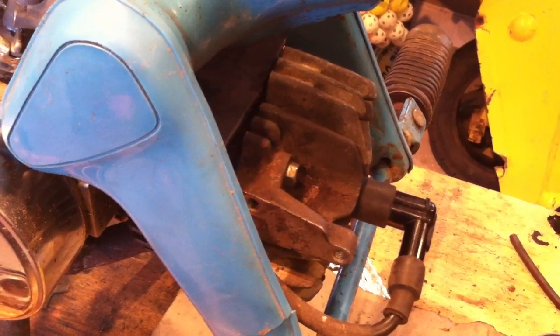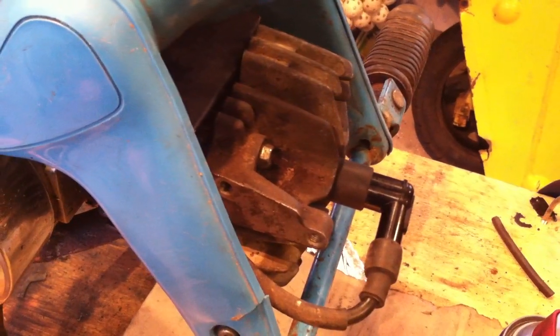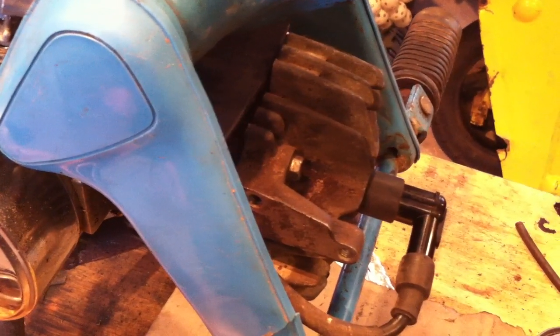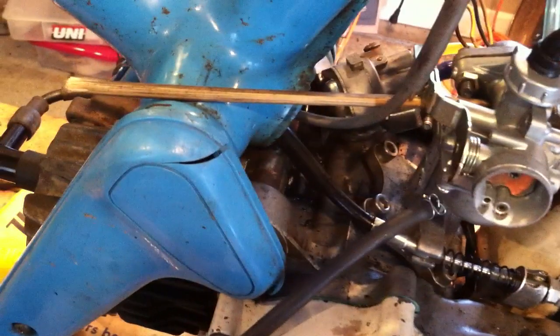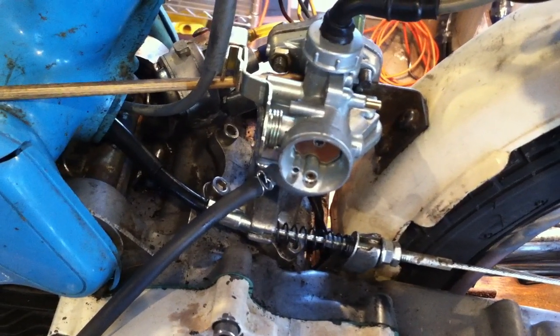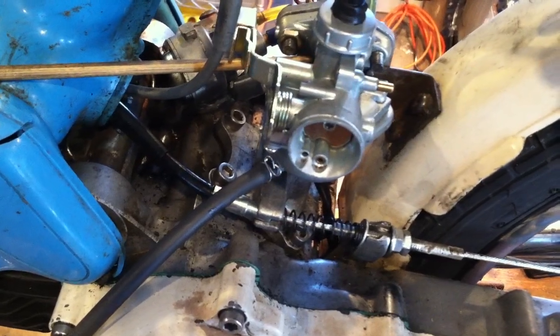On this cylinder that I did by hand, the piston doesn't quite come to the top yet — I've got some more sanding to do. But the compression is still pretty good even so, and maybe I don't want it as high as possible because more compression means more heat and more problems. I've also got some plans for the carburetor — just using this cheap eBay carb which has been working great, but I've got some other carburetors I might throw on here.